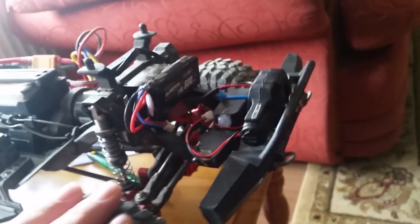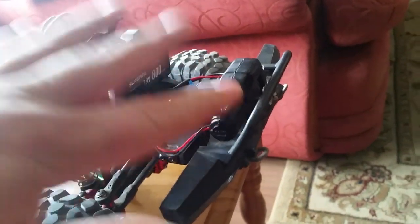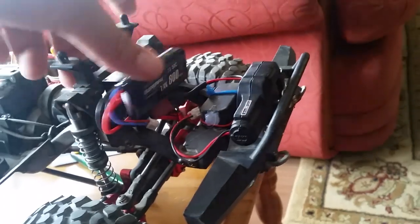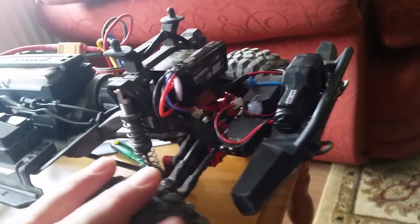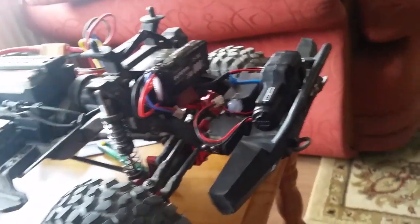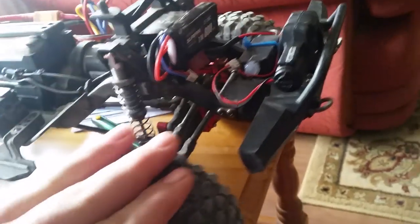The battery needed is a two-cell 800 milliamp 30C. I've velcroed it to the front of the servo so I can tuck the wires away out of the way of the wheels. I've mounted the transmitter for the receiver onto my remote. This thing performs remarkably well for the price - about 30 to 35 dollars for everything to have it running apart from your battery.